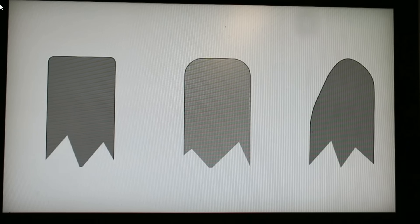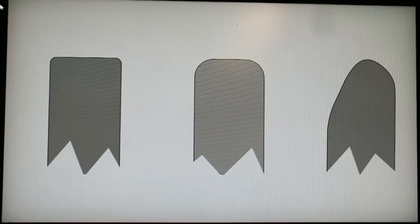What I'd like to do here is get into the details of the experiments I did for Tom at SCAT on the leading edge and trailing edge shapes of the counterweights. Up through the early 80s, this was your standard shape — the crank going to be turning this way, and this was a typical shape of the face of the crank. The rough forgings were always a lot rougher than this, and sometimes they didn't even have clean edges. But I've drawn a best case scenario.